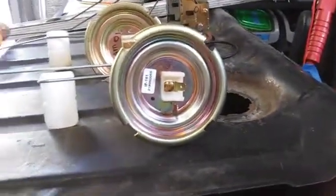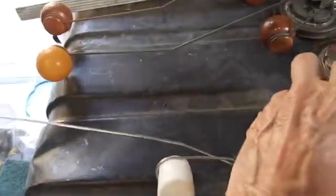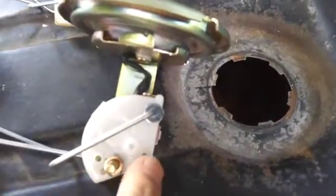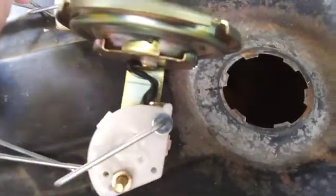That's the basic differences. The other is that the floats appear to be pretty close to the same, but they're probably from a different vendor. The floats on the Mexican are kind of rounded, versus the Impey has a tab. Otherwise, the body where the rheostat and everything is looks identical. I'm not sure whether the resistive windings for the rheostat are the same.